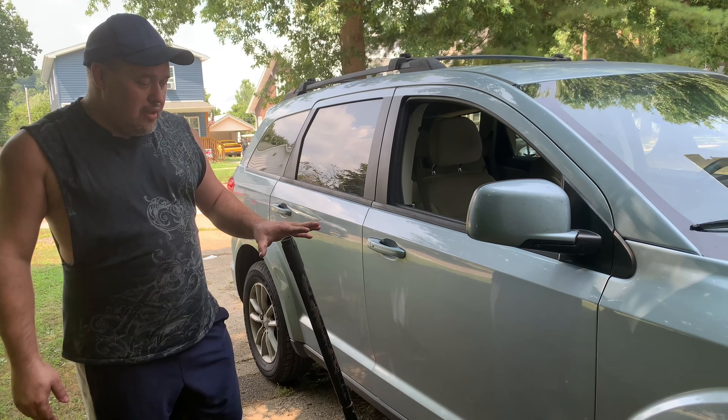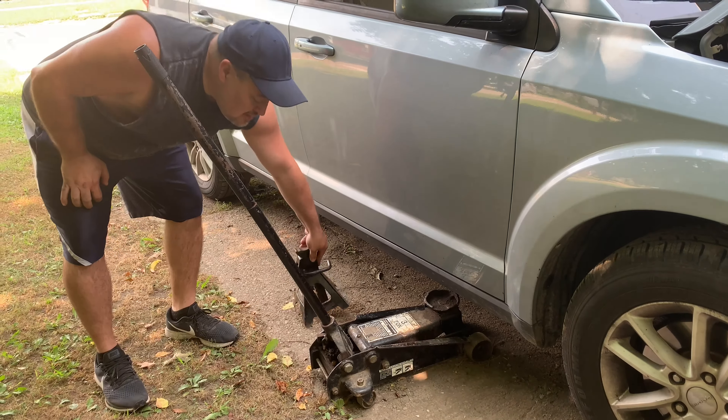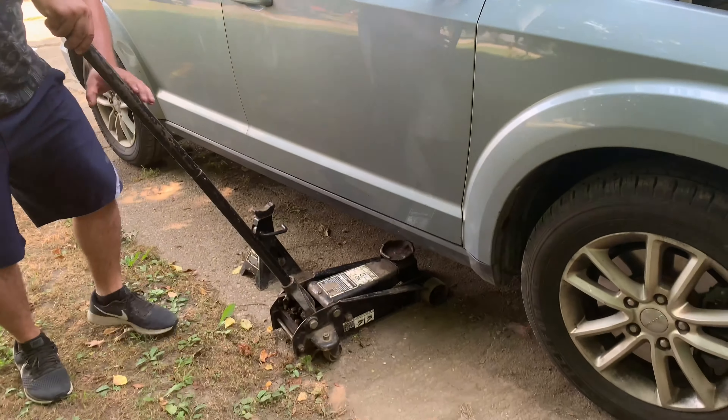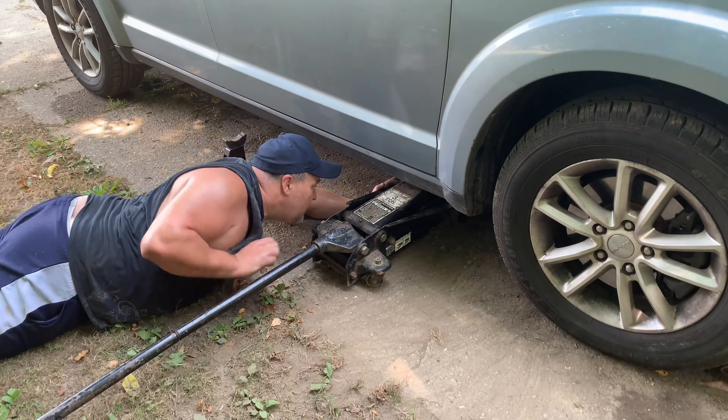I've debated which way I'm going to take this hose off, and I'm going to take it off up here because some fluid is going to leak out and I want this to be upward. If I take this off up here and hold the hose up, there's nowhere for the fluid to go, so it's less likely that more is going to leak out. I'm going to take a needle nose pair of pliers — there is a clamp here connected to the radiator. I'm just going to wiggle that clamp back. You don't want to pull too hard and you don't want to be too rough because this radiator is pretty much plastic — just be gentle and move it back and forth.